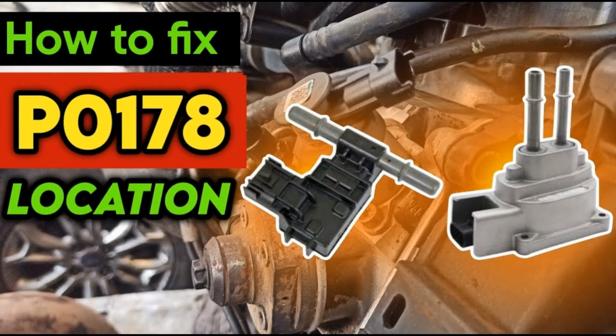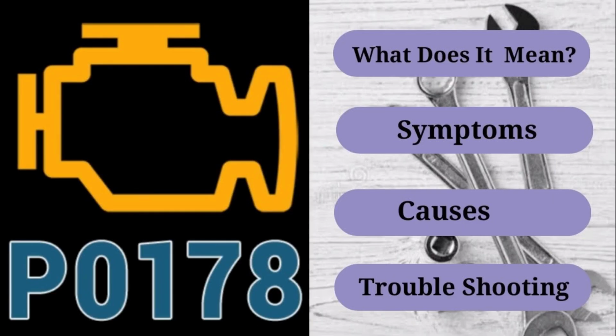All right, enough talking. Let's get into it. The fuel composition sensor measures the ethanol-to-petrol ratio in vehicles equipped with flexible fuel systems. It sends its readings to the Powertrain Control Module, PCM, which adjusts parameters such as fuel delivery and ignition timing in response. If the PCM detects the wrong electrical signal from the fuel composition sensor, it will set engine code P0178. What does P0178 mean?